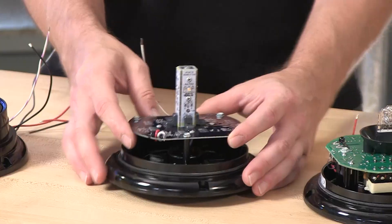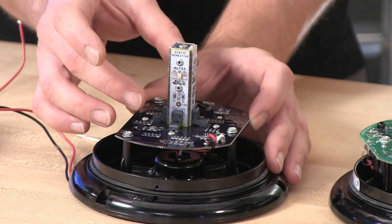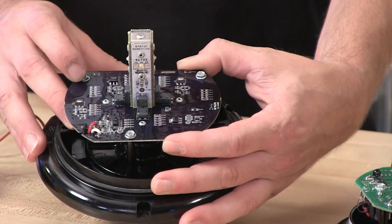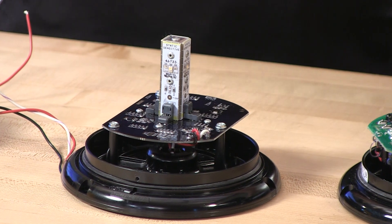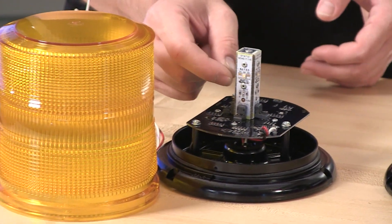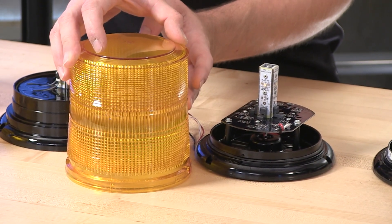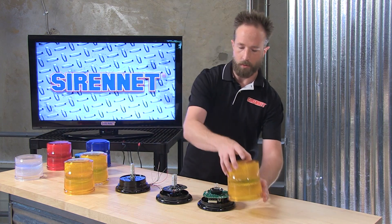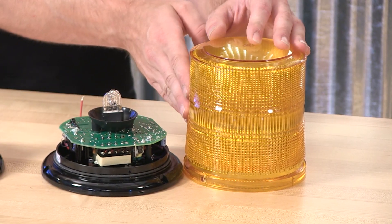On the L10, Whelan has put together a center diode tower that is arranged with four diodes. The tower arrangement has been constructed so that when the dome is overlaying the tower, the diodes are actually firing through the main center optic point — the power band. Same thing with the 2022: when the dome is next to it, you'll notice that the primary center of the strobe is going to line up with the power band.